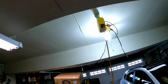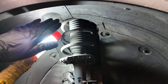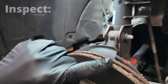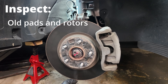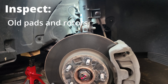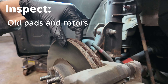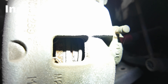We've uncovered our brakes — let's grab some light. Step two: now that we've got our wheel off, we're going to do a little inspection. First thing I notice is rust here. The vehicle has 70,000 miles on it and these are the original rotors. Overall the surface material and rotor wear is not too bad, but I can feel a little bit of a lip.